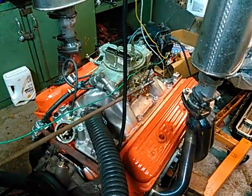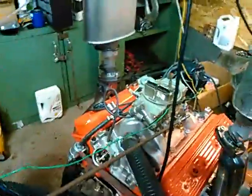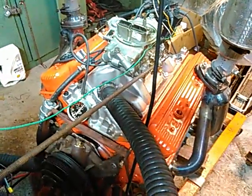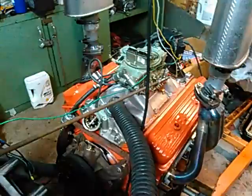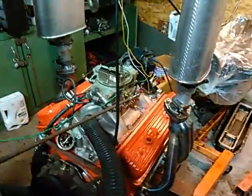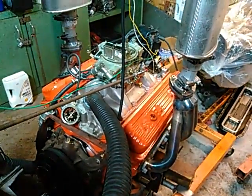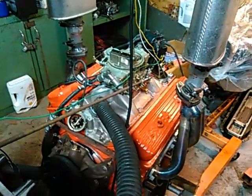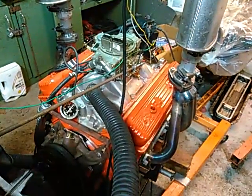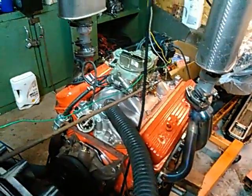There's overlap, but it's definitely a non-traditional kind of cam — not what came in your truck originally. It's from Comp Cams; I've got the cam card around here somewhere. I'd say about 50 degrees of overlap, something in that neighborhood. It'll run just like a bone stock motor sitting there idling, but when you get into the throttle, the red line will be 4,500 — it'll be done by 5 grand. But almost 500 foot-pounds of torque, if I can believe my computer simulation.